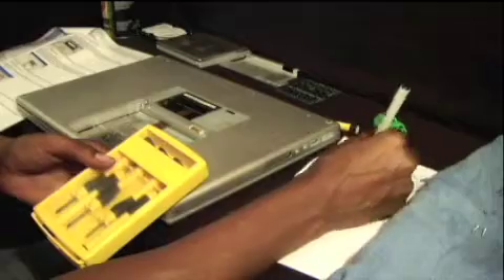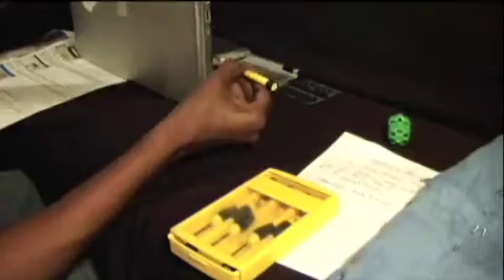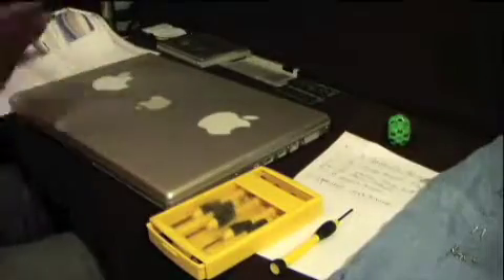When you're inside that battery compartment, there's a pair of Phillips screws you're gonna have to get out too. These are a little bit tricky, but not that hard. As you see, there are four screws located on each side of your MacBook Pro — you're gonna need to take those out. It's a little tedious, but it's fun.